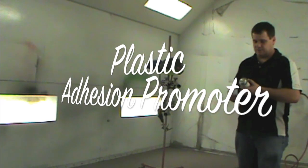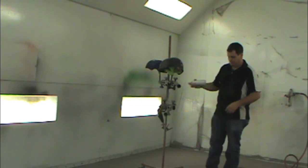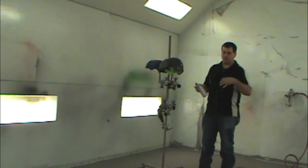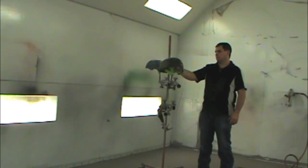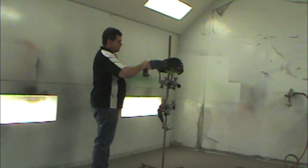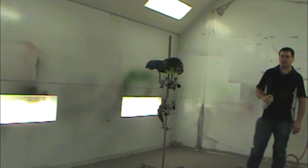I'm going to dry this for a minute. This is a 3M adhesion promoter. There are a lot of different brands that make plastic adhesion promoter — it's like a plastic primer, that extra little bond you need to allow your coatings to stick well. You always want to use an adhesion promoter with bare plastic, otherwise that's a lot of times why people have had problems with paint peeling from plastic. Put light coats on — you don't want it too heavy. Several light coats work well, then let it flash dry for at least 5 minutes. If it's been longer than 24 hours, you need to reapply before applying your coatings.